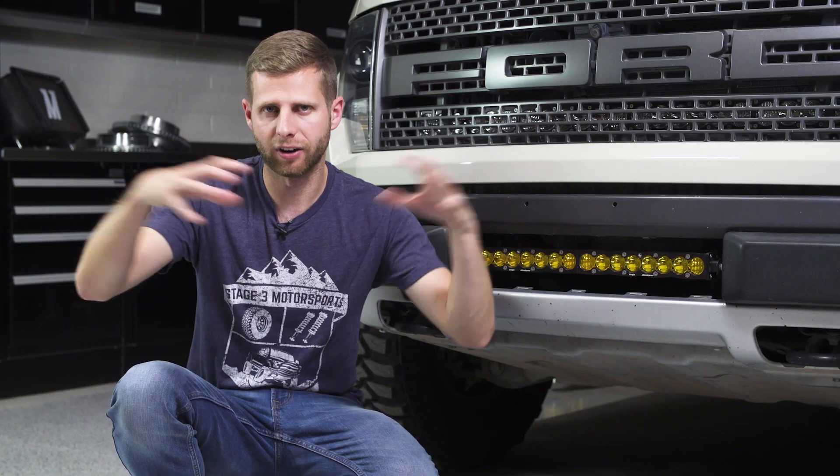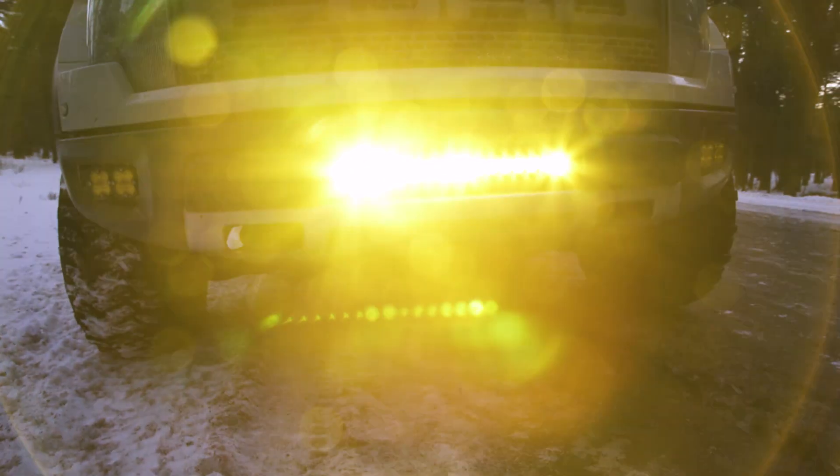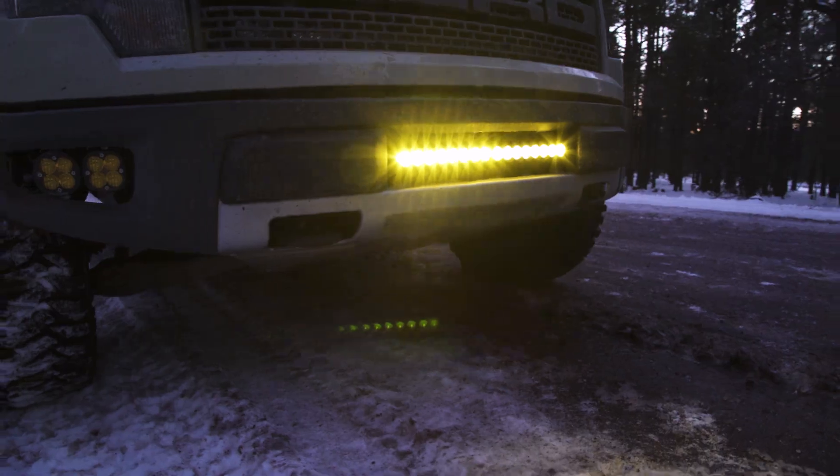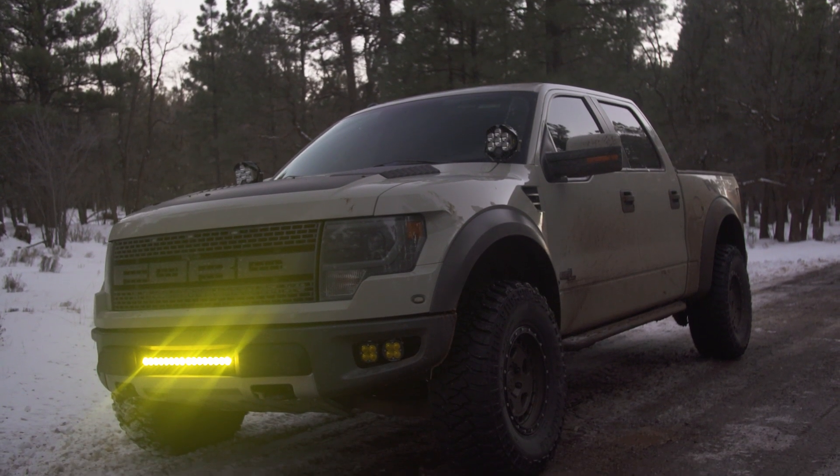On top of that, they also offer an area and scene light, which is designed more so for lighting up areas around you — if you're maybe putting it up on a rack or on your roof to catch an area of the campground or using it for a work vehicle, that's going to be a more ideal pattern. As you can see here, there are also different options for Baja Designs lenses as far as color is concerned, so they have both white and amber. We chose to run amber on ours, and typically amber is a little better for running in really foggy and dusty conditions, whereas white is a little bit brighter and offers more output but isn't always ideal in really foggy conditions.